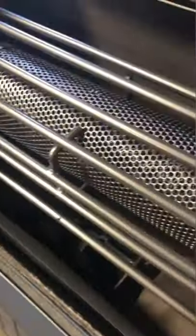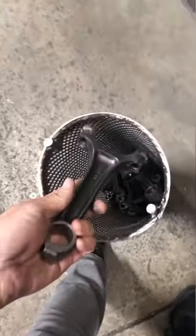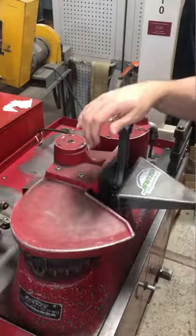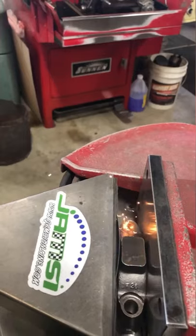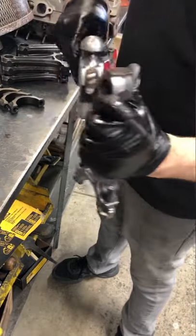I had a set of reconditioned Ford 351M Conrods sell on my website today, so I had to get some cores out and get to work. I started by blasting them in the steelibrator before cutting the rod and the caps on the cap grinder. This removes material from the mating surface so that when torqued, the big end is smaller than the factory spec.